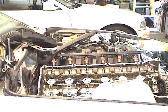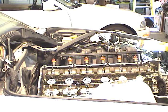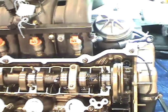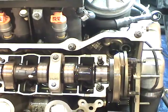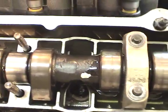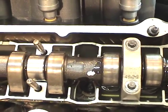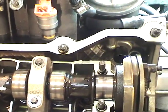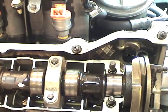Reassembly is just to get everything oiled up good, make sure we've got the lubrication, and then we'll put the cams back in. Okay, we've got the cam back in the car and I'm starting with cylinder two - I've got the journal cap back on. If you see that little mark on that cam, when on top, that is the sweet spot on the cam. I've got it set off just a little bit to take some pressure off and get the nuts started. Once I get one or two threads on the nuts, I'll turn the cam back to the sweet spot and then start the reassembly.